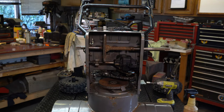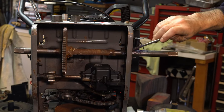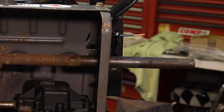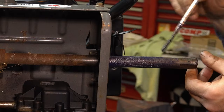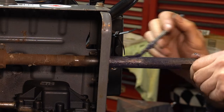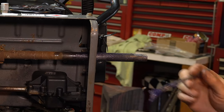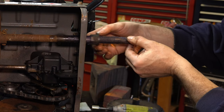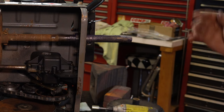Before we put the tires on, we're going to spend a little bit of time with some grease. I got this axle out and I'm just going to wipe the whole axle with grease, especially around the bushing area. The plastic bushings hold up really good — they also make a bronze oil-lite for bigger, nicer machines. We'll put a little bit of grease in our bushing and slip it on. You want grease because these are plastic rims so they don't get stuck.